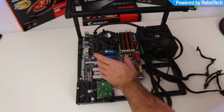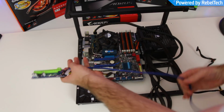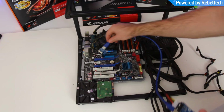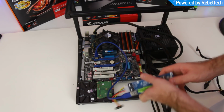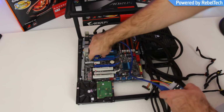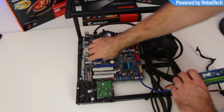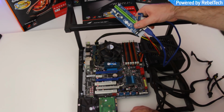All we have to do now is get the USB risers, which are these. Really simple. Like I said, USB PCI Express 1x, you can go straight in there, just like that, and then you can put on the riser here, or it can just go onto the 1x as well, no problem. So let's quickly get a GPU and connect it to the riser.